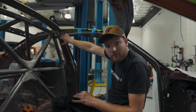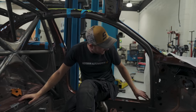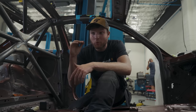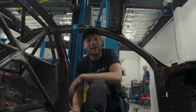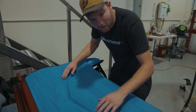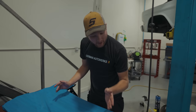The next stage is getting the front A-pillar bars in. They're looking nice at the moment and follow the contour of the car really nicely, landing down at the base. We've got to fit the mounting boxes, get them contoured and welded in. Then it's the big job — the door bars. We've brought the carbon door cards in that are now attached to the door, so we've got to get the bars made perfectly to fit the door card inlays. You can't have any misalignment — it's actually really hard to do.